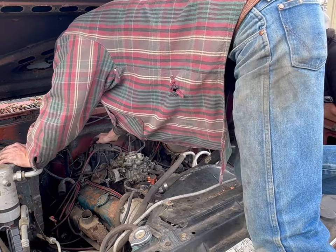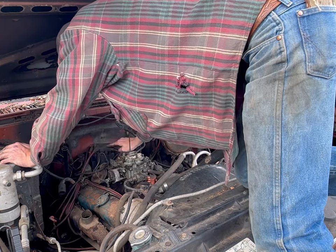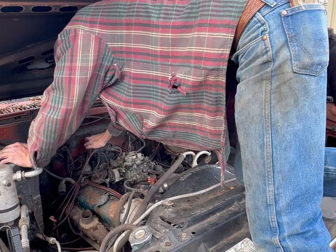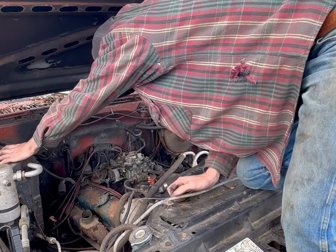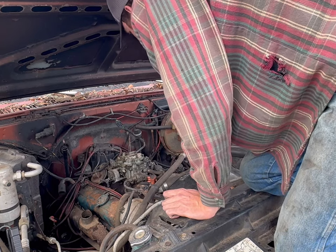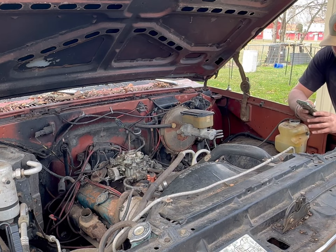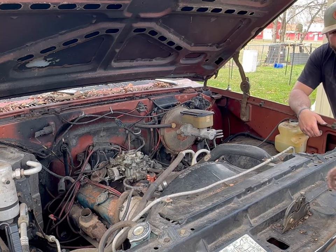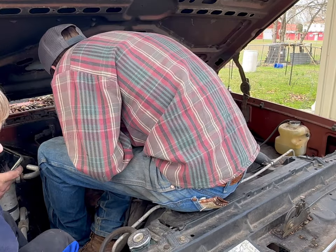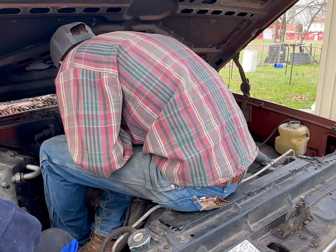Is it jumping through the ground and out on the firewall? But it was running on all a minute ago. I wonder if we found a plug. Well, I wonder if that electronic spark thing... I don't know what it does. Do you want to Google it and cross the wire real quick? I think it's the orange and green wire. You can splice it on this side. Just cut that one over there, on the back side of that plug, and splice. No, cut the other one and do your green and black together.